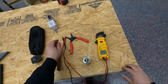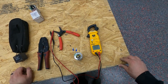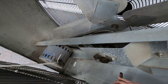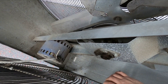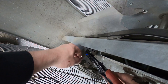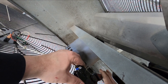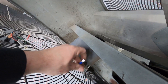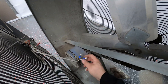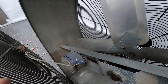All we're going to do is install two little spade terminals on the wires we cut, and then find a way to strap the capacitor up with some plastic strap or metal strapping. Strip the wire in the back and put these spade terminals on to plug into the capacitor. When you plug it in, it doesn't matter where the wires go — one goes to the common side and one goes to the capacitance side. In my case, I have the 7.5 and the 5 jumped. You could also just buy a standard capacitor with two terminals in the exact number you need. If you need a little extra wiring length, there's no harm in using a wire nut, a butt connector, or soldering them.